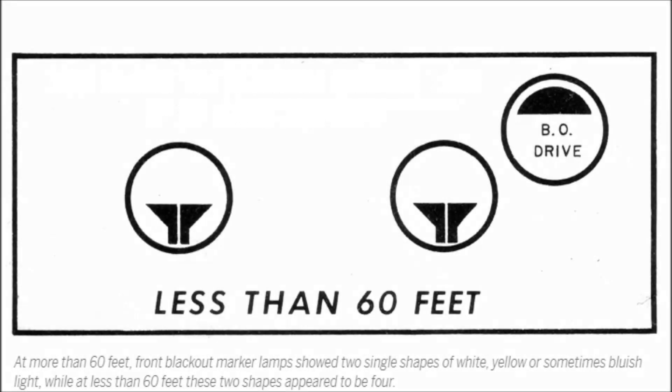These allow the vehicle in convoy ahead to tell how far you are in front. The blackout marker lights are really bright with night vision optics, but without that luxury they're very dim. If there's no light visible on the vehicle ahead then you're lagging behind. If you can see just one spot of light per side of the vehicle then you're just right at between 18 and 55 meters away. Two bars visible on either side means that you're about to collide.